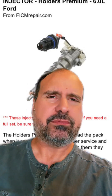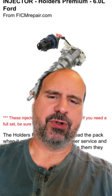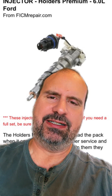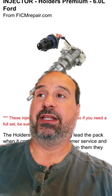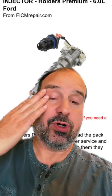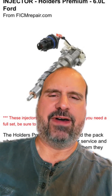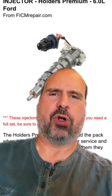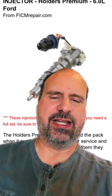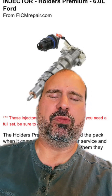I told him: if you do both of those tests and you're still having a problem, then yeah, it's going to be the FICM. And why would it be the FICM? Probably what happened is that following the injector work, whoever was cranking on the truck trying to purge the air out of the high-pressure oil system did not follow protocol.